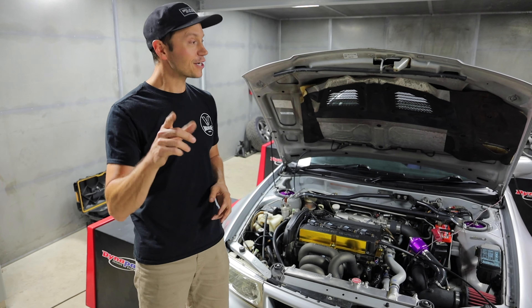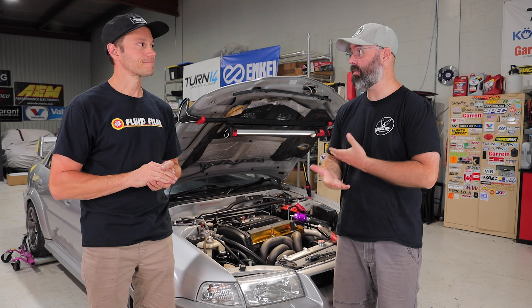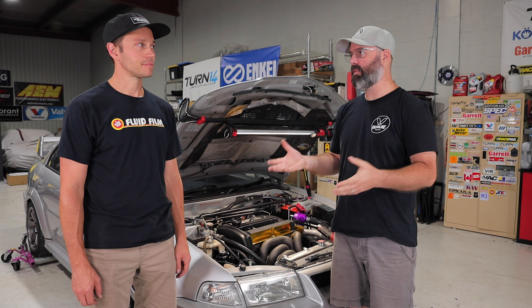I spoke with Andre from HB Academy, and I should say up front, this is in no way their fault. We built the engine our way and chose not to deck the block. In their video series, they very clearly say to deck the head and the block so you get a good seal. Our machinist said we'd be okay without doing that, and we took his advice. That may be what bit us. And we even sent pictures to Andre while building the motor, because Pete noticed there was a bit of pitting on the deck. Andre said we should deck it, and we decided to go ahead without it anyway.